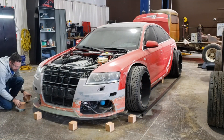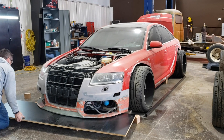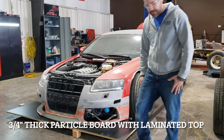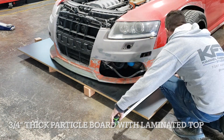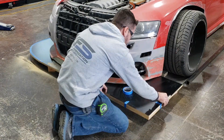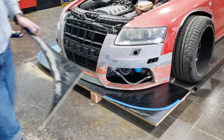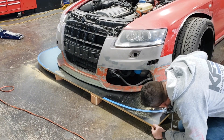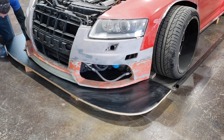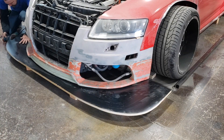I cut a bunch more wood blocks all at four inches, since I decided that's going to be my height for the sides and the front splitter — pretty much everything other than the very back of the car. I get all the blocks laid out and then grab my three-quarter inch particle board to use as the base of the splitter, just to make a mold. I use a tape measure to center the board, then use blue tape to lay out a line for the beginning. Using the blue tape as a cut line, I bring out the jigsaw and trim off the corner, then transfer the cut piece to the other side as a template to make sure the shape is the same side to side. I trim the other corner, do a final check for squareness, then use a rotary sander to clean up the entry and exit marks from the jigsaw and round off the edges.